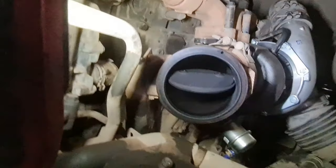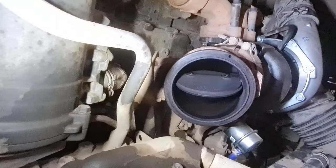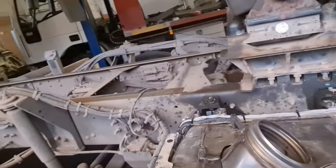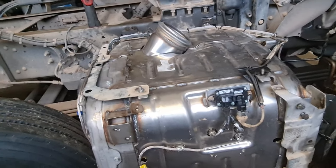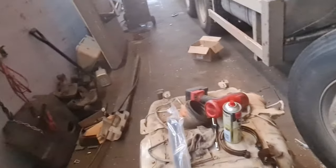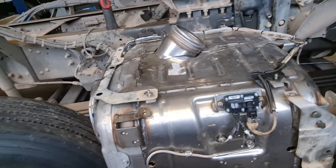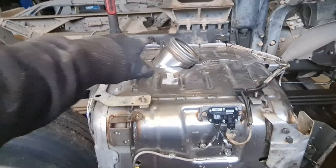I've taken the stack off — imagine my arm — that's the stack, getting that cleaned. I'm also going to take the other stack section off and get that cleaned as well. I've had the engine running with the exhaust off, and the only thing that's come out of the turbo is a bit of condensation — there's no oil coming out. I'm pretty confident the oil that filled the old exhaust was from when the old turbo collapsed, but when you're spending ten grand you need to be checking these things.